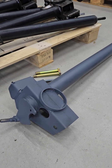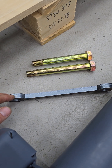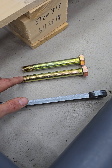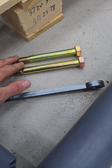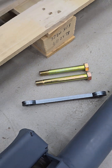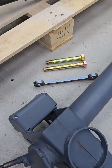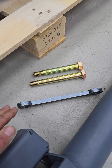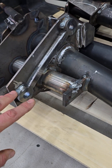We prefer our carrier plate washer, which is now 12mm for production axles and workshops. Just be aware you need a longer link pin if you're using our carrier plate washers — so if you buy a bush kit from TRAC it'll come with these link pins, but ours are physically much longer. We do sell the original link pin, but whenever we refurb suspension or do a suspension overhaul, that's the one we prefer.